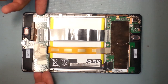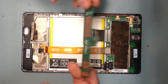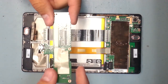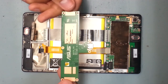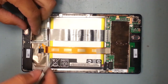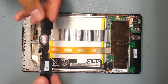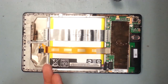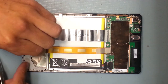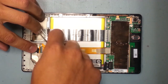The circuit board is now free from the housing, so I lifted it up. This is the charging port — this is the part that you'll be replacing. Parts are cheapest on Amazon, so I'll list that in the video description below. Then we have the bottom speaker, which fits right underneath the charging port. There's also a ribbon cable at the bottom — lift up the black sticky tape, find the latch, flip the latch, and pull the ribbon cable out. Pretty straightforward.